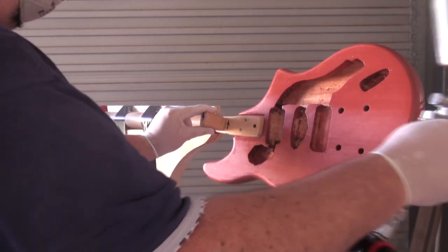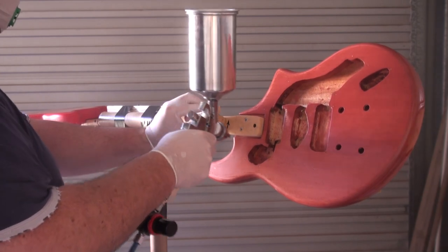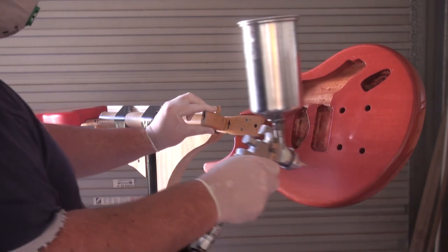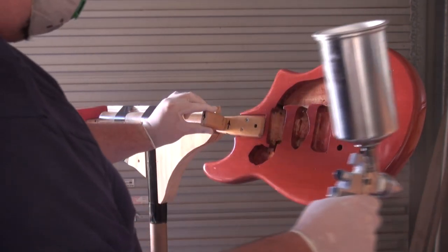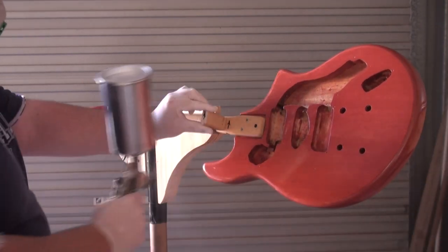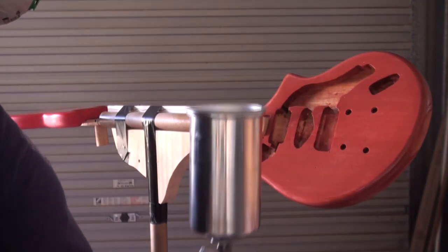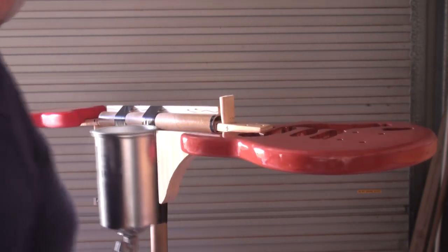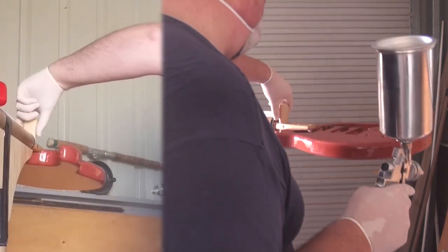By this session on the 7th of May, I had enough of runs and decided on a new process for laying down paint and clear coat. I lay down two passes of extremely thin coats and then I wait 15 minutes for the coat to become tacky and firm up a little bit before hitting it again with a further two passes. I find this is the best method to avoid runs and not lay down too much wet material at once. I was following this process during the second session on the 7th of May 2017.